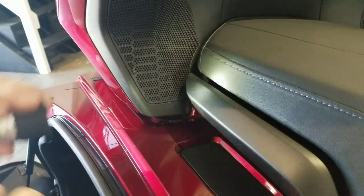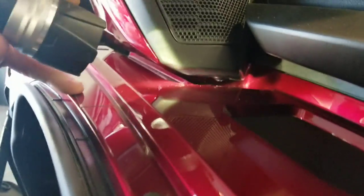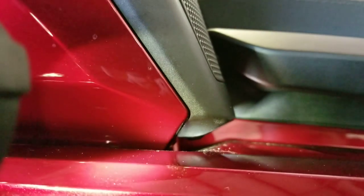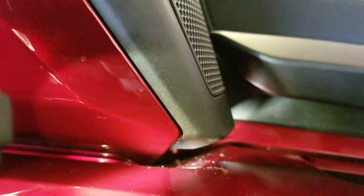Try and tape this area, but very specifically there's one screw in there that's pretty much guaranteed to come around the side here. You'll see that literally the act of pulling it out it's headed right for the bodywork and it's going to want to scratch it. So there's just a little tip to be aware of.